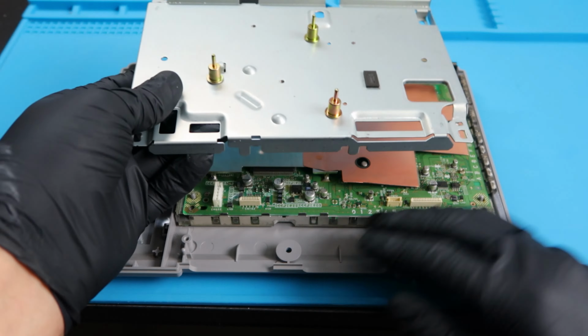So we're going to start with the bottom shell here, and we're going to go ahead and grab the bottom metal shielding and place it into the shell like so. You'll know you did it right if all the plastic pieces fit through their respective holes there. Same thing with the motherboard. Make sure the plastic pieces fit perfectly through the holes there. And the ribbon is perfectly fine sticking out the way it is there. So we're going to go ahead and attach 1 screw by the AV port, another one by the IO port, and then 2 more by the other IO port.